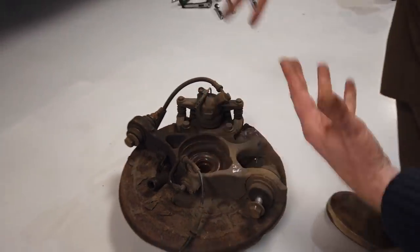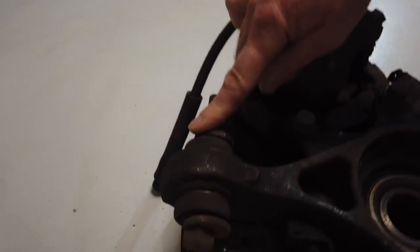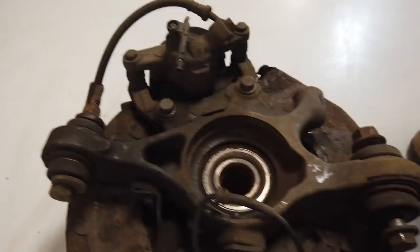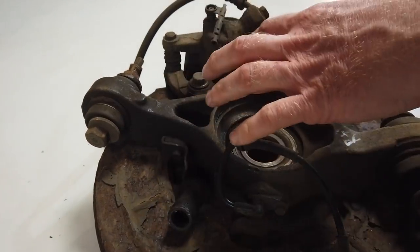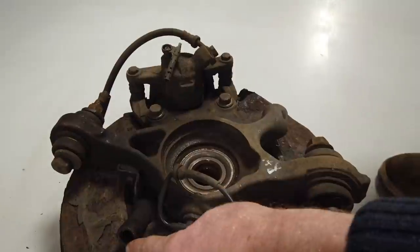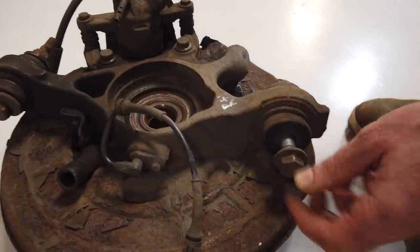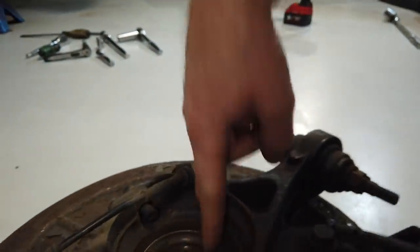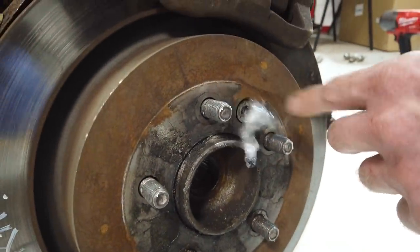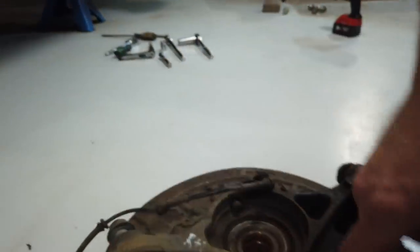Let's have a look at what things we've got joining into the car. We've got one bottom bolt here. We have to undo the handbrake - on our car the handbrake cable's been cut, so we won't cover that, but you will have to take the brake disc off and disconnect the handbrake cable from inside. Then there's the tie bar bolted into this hole here, and obviously you've got your drive shaft going through here on a spline. There will be a big hub nut on there.